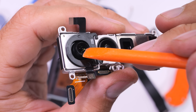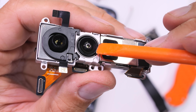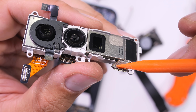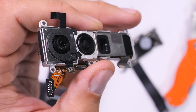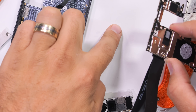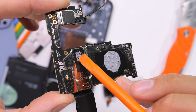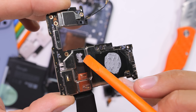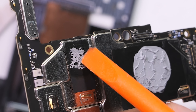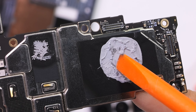On the left we have a 50 megapixel main camera with OIS, then a 48 megapixel 5x optical telephoto which also has internal optical stabilization. There's thermal paste on the back that helps bridge the air gap between the Tensor G5 chip and the copper vapor chamber of the phone. There are also some mesh strands on the other side — it looks kind of like a drywall patch, but it probably has something to do with cooling, some kind of air gap Google wanted to fill.